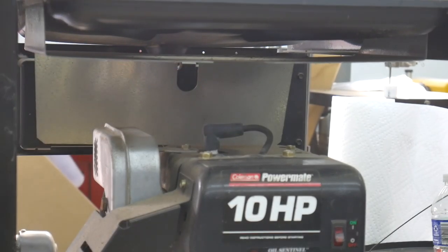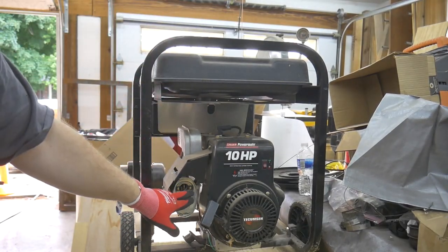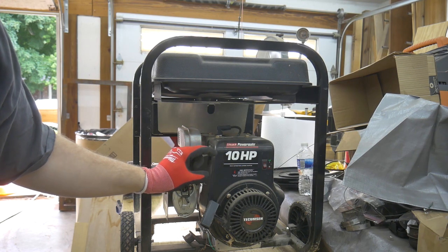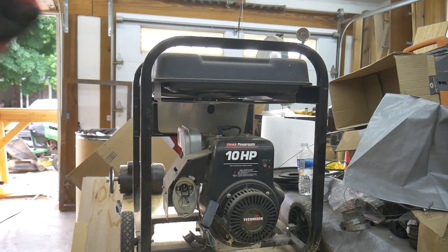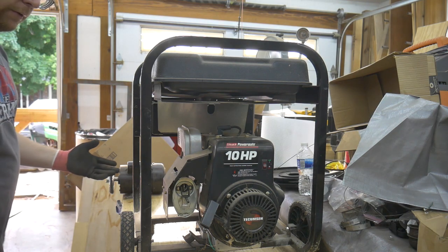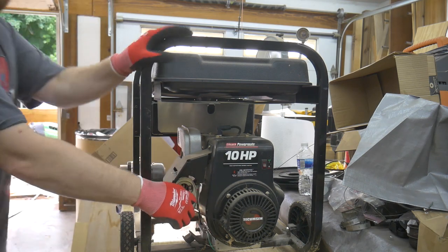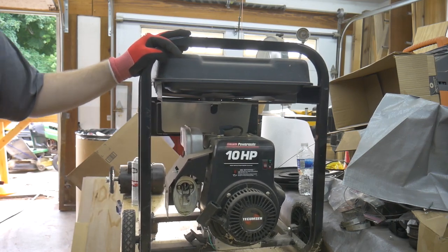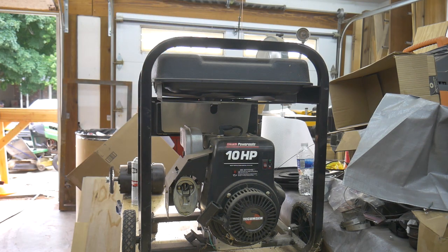This may be a little controversial, but I'm going to give the air intake just a little sniff of starting fluid — just a tiny amount — and pull it to see if she fires over. There's no reason why she wouldn't. And it looks like we have ourselves a runner here. This one might just be easy.